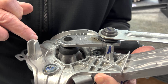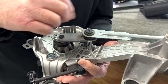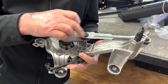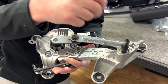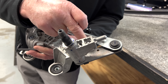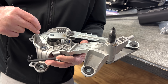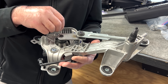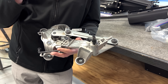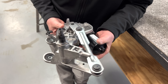As the bell crank moves, you can see it hits a stop here and then comes around and hits a stop there. That motion pulls the slave around and turns the driven bell crank. This is the driver bell crank, this is the driven bell crank, and this is the slave. When the driver moves from this location to that location, it pulls the slave around, and the driven bell crank is what moves the windshield wiper back and forth.